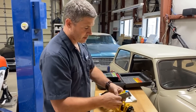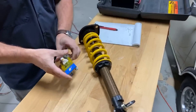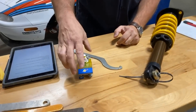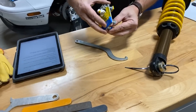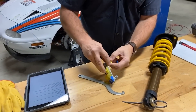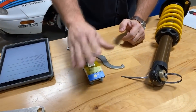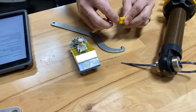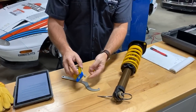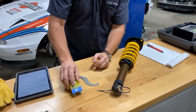Let's use our little spaceman again for illustration. We have a heavy diagonal — this little car is carrying a lot of its weight on these two corners. If we simply lowered just those heavy corners, we might get it level, but it's going to be lower than it was because our average ride height drops. If we adjust the heavy diagonal corners down by a little bit and the light diagonal corners up by a little bit, we can end up with the same average ride height and the same stance. That's the trick: adjust all four corners, not just one.